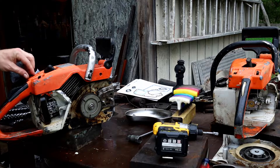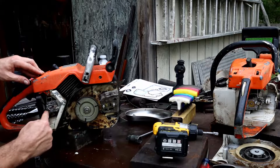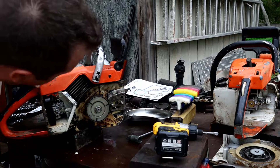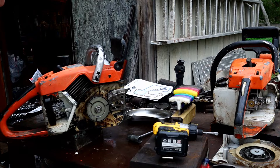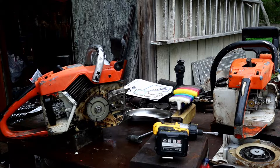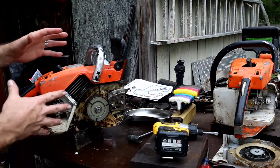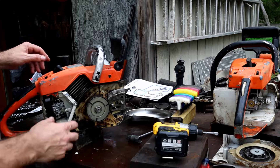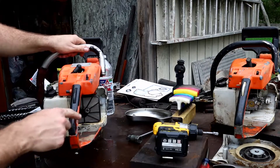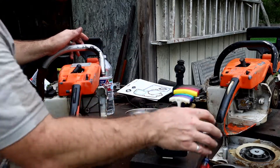You've got the choke and stop with wires. The linkage comes down and is e-clipped into the carb. That carb looks pretty good in there. Right now I'm just trying to get a good assessment of what's what on both saws, get the handles off, and start compiling a good parts and bad parts list — parts on one that'll work on the other. Here I've got a broken plastic handle; the other one has a good plastic handle.